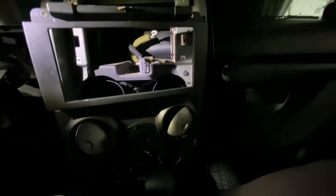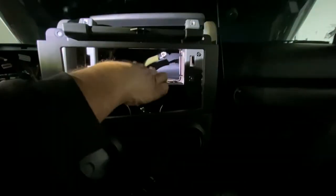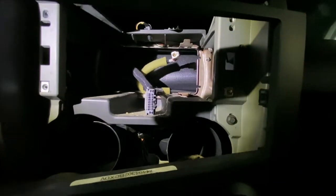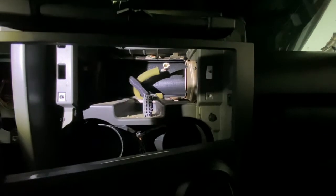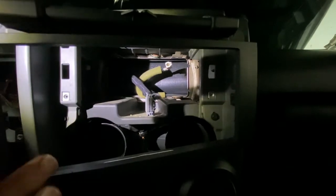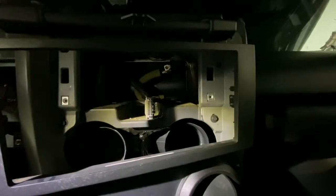I'm gonna explain the wiring. For some reason, in this stereo plug, there is not a switched voltage. Meaning when you turn the ignition on, you're gonna have battery power, but when you turn it off, you're not gonna have battery power. Because the radio needs a constant power — which is for memory — a switched power that turns on with the ignition and shuts off so the radio doesn't stay on when you turn the key off, and ground. For some reason, this doesn't have the red wire, which is the switched wire. So you have to find an area where you're gonna have switched power from the car.